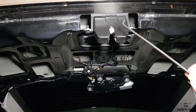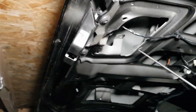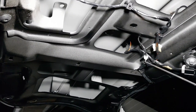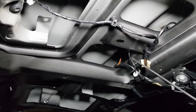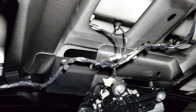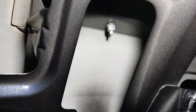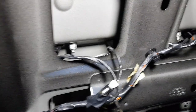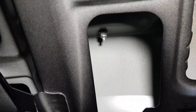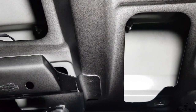This is the tailgate lock itself, and from that we've got the short wiring loom which runs down to a join with some of the other bits of loom. Then there's this little white connector, and a little thin wire that runs through a grommet out into the handle and into the switch itself. So we need to get the handle off — all it is is four little 10mm nuts straight across it. There's two in the middle that are a bit fiddly, but a little flex head ratchet or a spanner will do you.